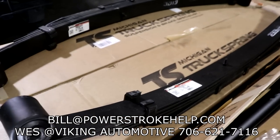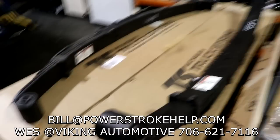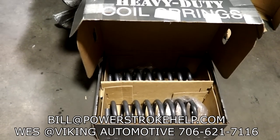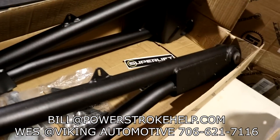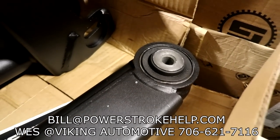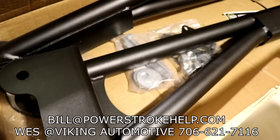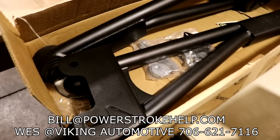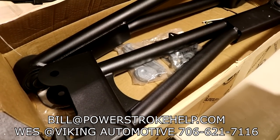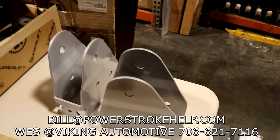So we're going with a 3,000-pound spring. There's another step beyond this — 3,600 — that you can go with from Michigan Spring; it's truckspring.com and we've bought springs from them for years with real good luck. Then we're going with a standard set of 250 coils on the front. The other part we're going with is adjustable lower control arms on the front. The size of the bushing is massive. It's slotted where it attaches to the front differential, which allows us to kick the bottom of the differential out and get as much caster as possible. The adjustment cams also allow us to center the front differential under the truck so it tracks straight down the road. In addition, we're running drop brackets that let us drop the control arm down a little to get more caster.